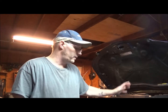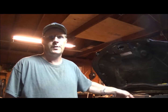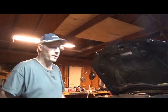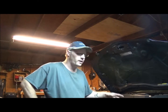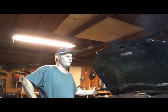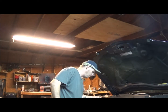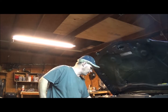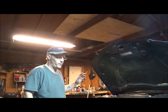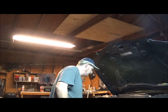I'd really like to get this figured out for him because he needs his SUV. I'm moving over to cylinder four for the compression check, doing it dry. Just checking these two cylinders won't tell you everything going on in the engine, but it will tell you what's going on on this side. If cylinder four doesn't come close to cylinder two, we'll know something's probably really wrong. I know it should be way higher than 90 psi — most naturally aspirated engines have pretty high compression.